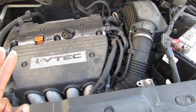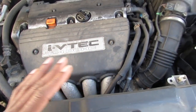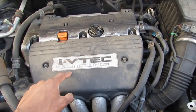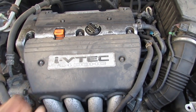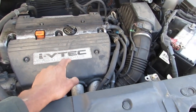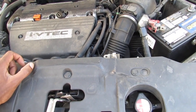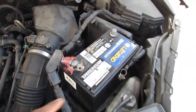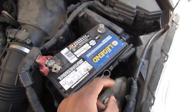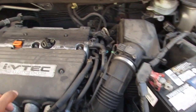We're going to do a couple things to test and make an assessment of the engine — just the condition and everything. This is a four-cylinder i-VTEC 2.4 dual overhead cam. It's also got a parasitic draw, so we'll need to remove the battery from the system, but we'll figure that out after we deal with the head gasket.